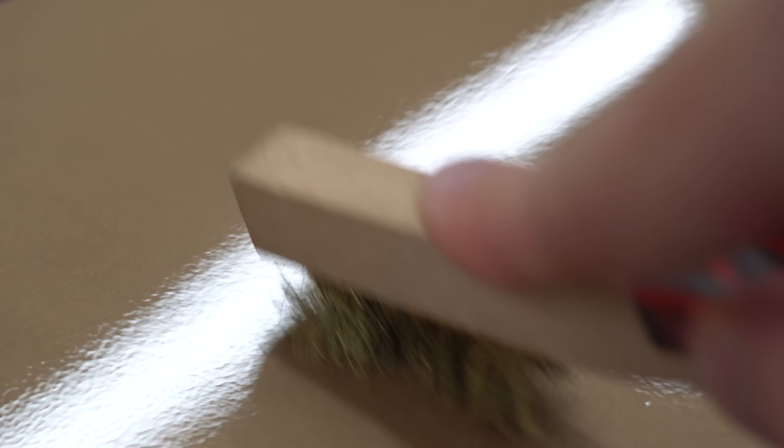As you can see, you can still scratch a ceramic coating, even when it has a scratch resistance of 9H — the highest rating on the pencil hardness test and the standard for a good ceramic coating. Next, a heat gun is used to heat up the surface, and just like a non-coated Expel paint protection film, the surface heals just fine.